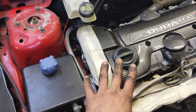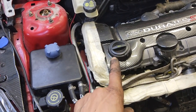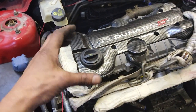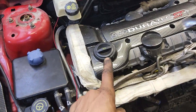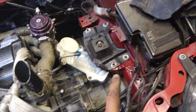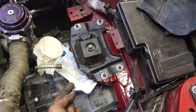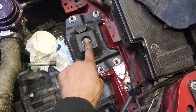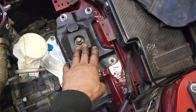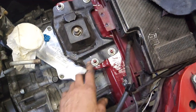The engine mount on the engine side is completely reused. The engine sits in exactly the same position as factory — up/down, left/right, and rotation — so that mount works 100%. The upper part on the other side also works 100%, and as part of the kit I'm supplying a bracket that bolts onto the gearbox with a centering bolt, going through into my bracket, allowing you to use the factory upper rubber mounting.